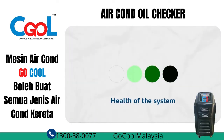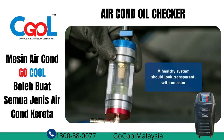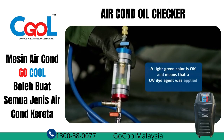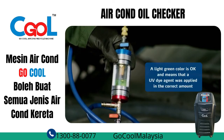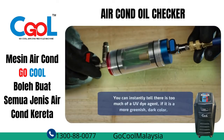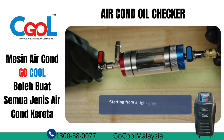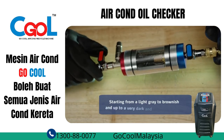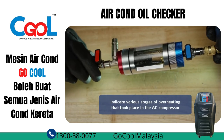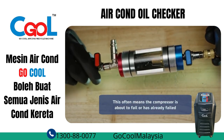And finally, the color of the mixture tells you all about the health of the system. A healthy system should look transparent, with no color, like water. A light green color is okay and means that a UV dye agent was applied in the correct amount. But heavy use of UV dye is very bad for the system — you can instantly tell there's too much if it's a more greenish dark color. The dark color range of the mixture, starting from light gray to brownish and up to a very dark and even black color, indicates various stages of overheating that took place in the AC compressor. This often means the compressor is about to fail or has already failed.